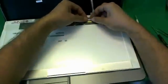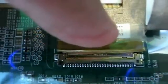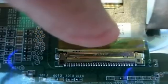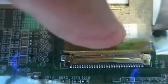Let's go over this part a little bit — when you put the connector back in, this is the biggest source of trouble I see. Make sure it's properly connected: when you slide the connector back in, you'll feel two clicks — you won't hear them but you'll feel them. Pause the video right there and make sure your connection looks like this. There should not be a gap in the seam between the two sides of the connection — the connection should be flush like this.